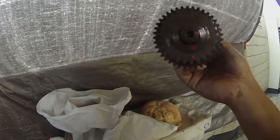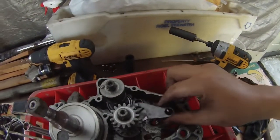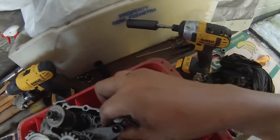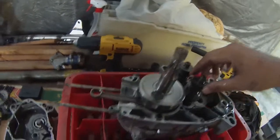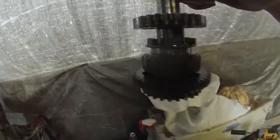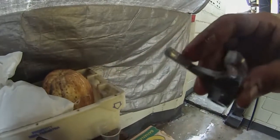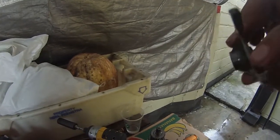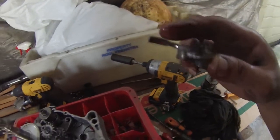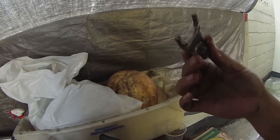At least the gears look okay — they don't look that worn, or they don't even look worn. This hits the third gear, so I think all in all it's just the one gear fork — it's chewed down. So I think if I change this out I will be good, hopefully. I have to put another gear fork in, slap the motor back together, and I'm all good.